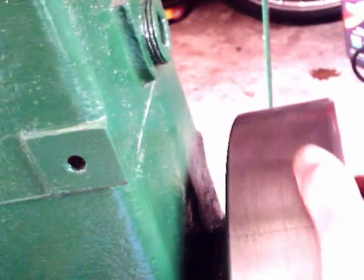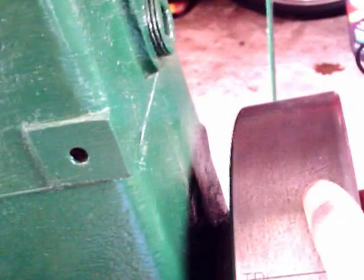The method I use is to gently rock the flywheel backwards and forwards — that should enable you to see the points opening and closing. Just a couple of things about the timing mark: on D-type flywheels the top dead centre mark is still clearly visible, but with years of corrosion the little lightning mark, which is more delicate, the rust just eats that away and you can't see it. So if that mark isn't visible, you can find the top dead centre line and just take a tape measure. If you measure about two and three-eighths of an inch clockwise, that's where your ignition timing line should be.